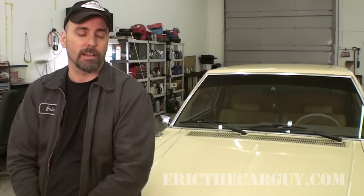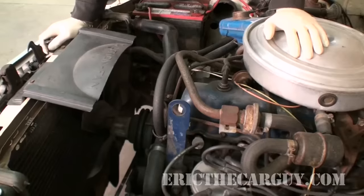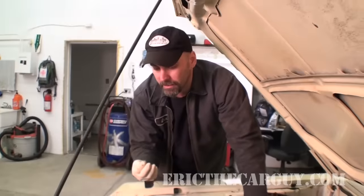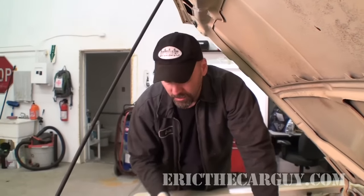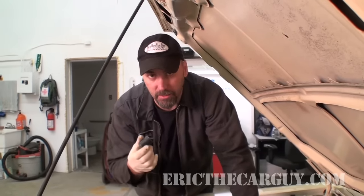In this video we're going to run through just a few simple checks to determine if you have timing chain slack. Rather than talking about it, let's get under the hood of the Ford here and get started. One of the first things we need to do is figure out what size the crank bolt is, because we're going to have to turn the crankshaft during this test. It's going to be a 21 millimeter to rotate the crankshaft, so you'll need some means of rotating it. You'll also need to know what direction the crankshaft normally rotates — many engines rotate in a clockwise fashion, however some do not. I'm going to grab a half inch ratchet to go with this socket.